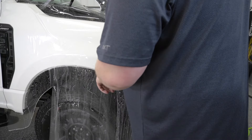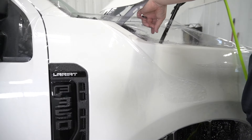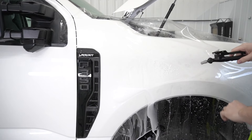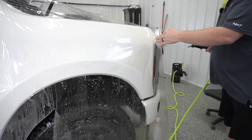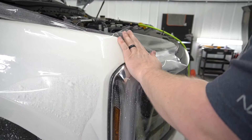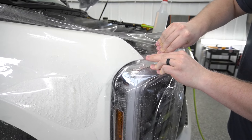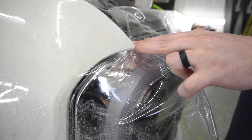You can see one thing we're having right over here is the PPF is stuck, and I don't want to pull on that too terribly much. So I'm going to come around from behind the hood and pop this up. Now we can take and stretch everything into place right over here at the front. I'm just pulling the film back, getting my tack solution behind the film. I don't need a lot of stretch, but I'm going to do just enough to hook that film around the corner — not perfect coverage around that corner, which is usually very hard to do.